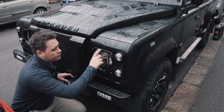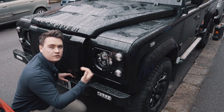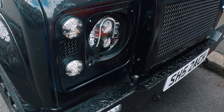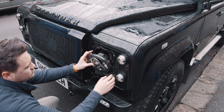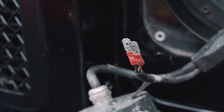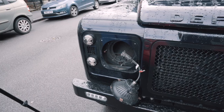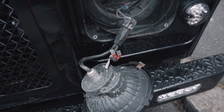The first thing we need to do is remove the headlight itself. I've got bezels around mine so I need to undo those, then there are two screws that attach the light into the car. Once the surround's off there's just one screw to undo to remove the light. You can then pull the light out and get access to the back. Here you can see the daylight running light wires are already connected — these are what are going to connect into our new loom. Both lights are now pulled out and we've got access to the DRL wiring.